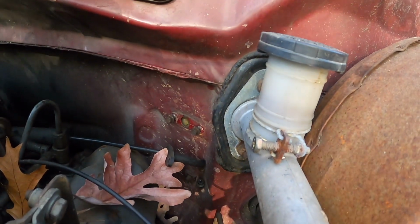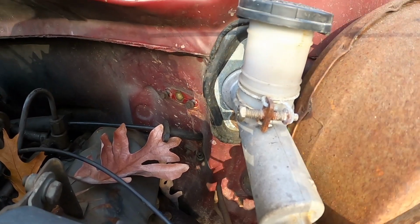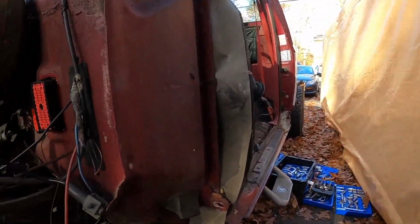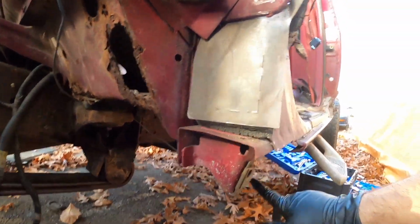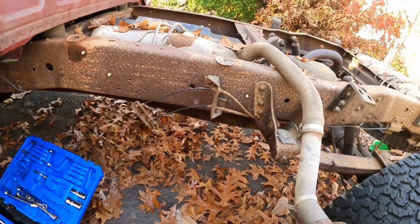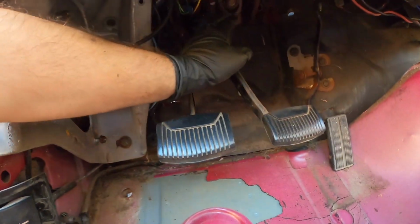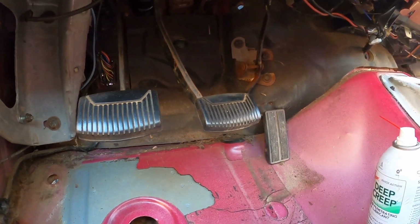Right there, those two little screws, that's where the throttle control was for that wire. So I took them out already, took the wire out. Just connect these two. The e-brake came through here and went around all the way down to the back. So it came back here, and I disconnected it from here, which is pretty easy. All you gotta do is move these and then pop them out. And also you gotta disconnect your steering. I disconnected that already, it's already out. And I think that's basically it. I don't think there's anything else that I need to disconnect